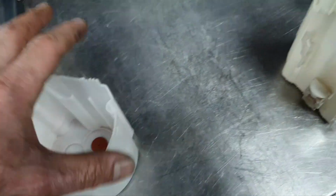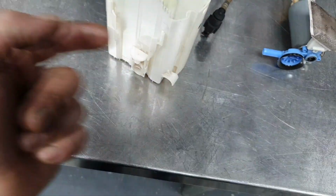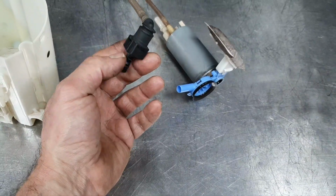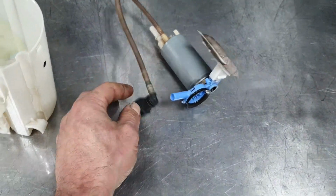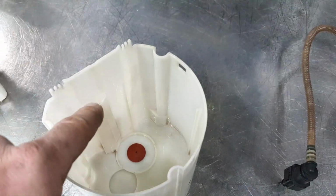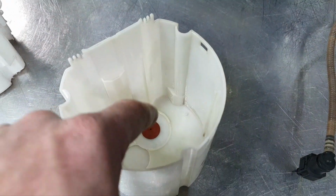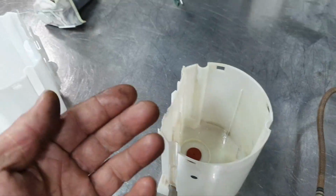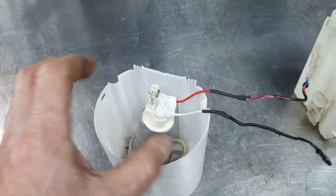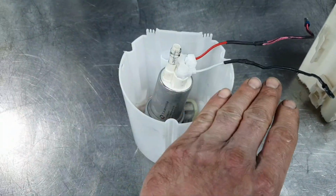And it's relying also on the Venturi valve, which has a similar valve on the other side of the fuel tank that's supplying fuel pressure with this pipe, and it ends up here and dumps the fuel through this opening inside of the bucket. All right, so this pump is working fine as long as you have this basket or bucket full of petrol.